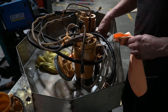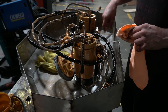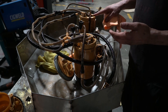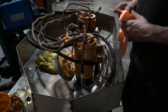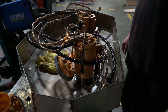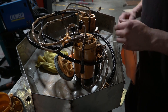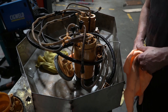This is a little float level thing, same as you've got in your toilet. That is clear of anything, and when it's at the bottom, obviously it's touching the bottom of the tank. There's another one here in the middle. I assume these are because on the original tank it was possible for one side of the tank to go dry — so if the pump detects that it's dry, it stops pumping fuel and relies solely on the other one. That's just a guess. The rest of the stuff is just a garbage amount of fuel lines and things like that. I'm quite happy with it. Now all I need to do is make a few tabs — I'll probably weld them in so that I can leave these quarter-turn bosses in there permanently, and then I can just quarter-turn these, pull them out, and that's it ready to go. It also means in the future it's going to be very easy to replace these without having to do something stupid like remove the tank.